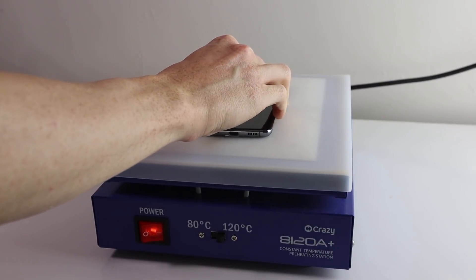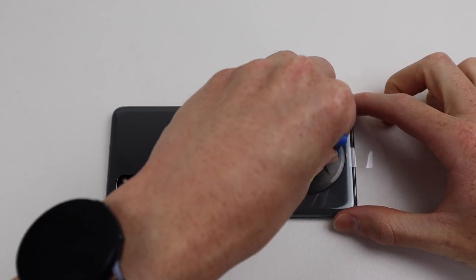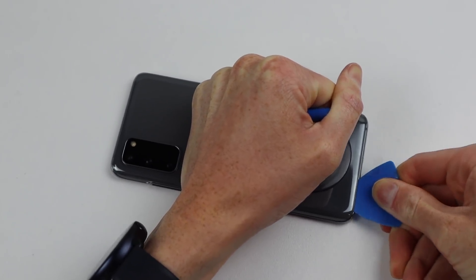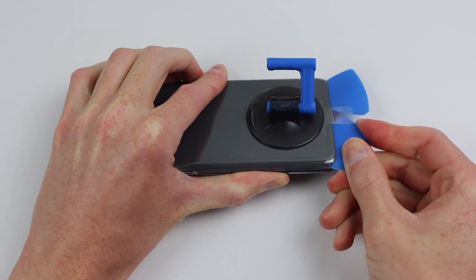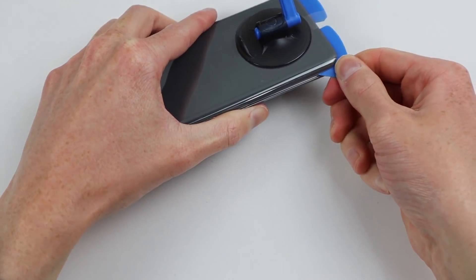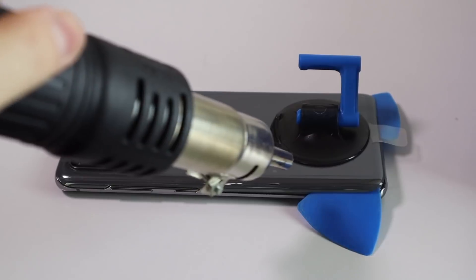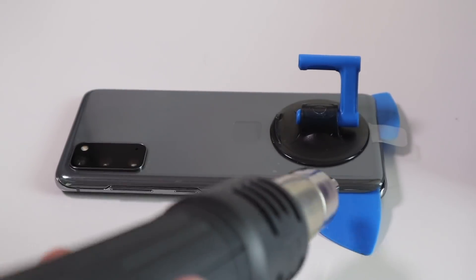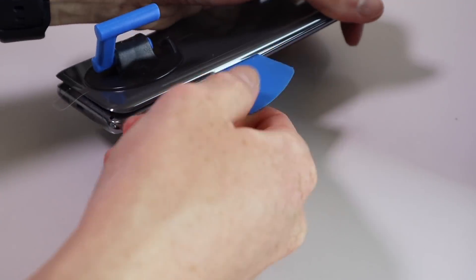With both phones unboxed and set up, it's time to crack them open to see how repairable this phone is and whether any components are locked, as we saw when working on the iPhone 12. The back of this phone is glued shut, so I'll need to use a heat plate at 120 degrees to soften the adhesive. However, a heat gun or similar method could be used to achieve this. After a few minutes on the plate, I could remove it and use a suction cup to create a gap just wide enough to insert a plastic pick. Getting the initial gap is the hardest part. The heat plate evenly spreads the high temperature, which makes this step much easier than using a heat gun. However, the curved edges are much harder to heat with a flat surface, so I used a heat gun on the sides so I could easily slide my pick around to separate the back panel without cracking it.